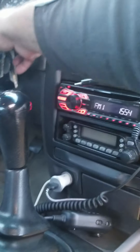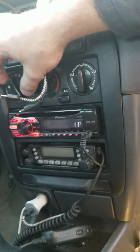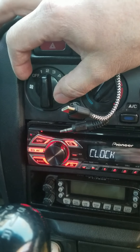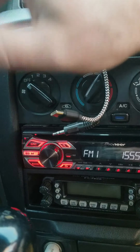It should be relatively easy — takes a little bit of pressure to push the connector into place until it clicks. Make sure everything's snug and correct. Now I'll cycle it back off and back on — I have level one, a little higher, three, and four. You can see that did fix it. It's a 98 Nissan Sentra with a 1.6 liter — relatively easy item to replace.